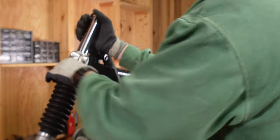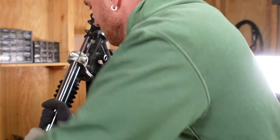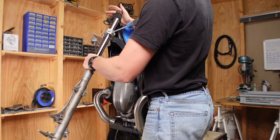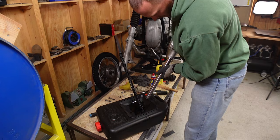Now we get to the part that I struggled with the most. The fork tube sat so tight in the bike that I had to use the blowtorch to heat up around the triple clamps so I could pull them out bit by bit. That's actually not the right way to do it. I found a little trick in Brooks Airhead Garage's videos — if you have a BMW you probably know that channel, and if you don't, you definitely have to check it out. All you have to do to make your life a hundred times easier is to take a large blade screwdriver and gently tap it into the slot on the triple clamp. Once you have the fork out of the triple clamp you can take the spring out, mark the top side, and drain all the oil by pumping the forks a few times.